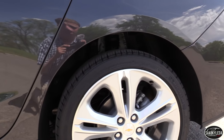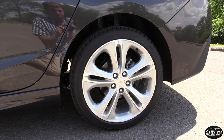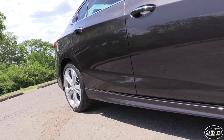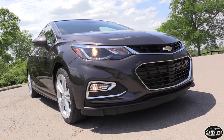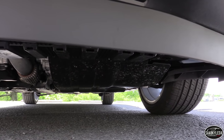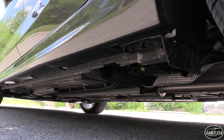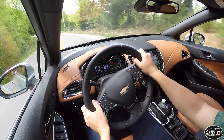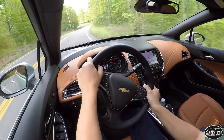As far as the brakes, the 10.8-inch front rotors are internally ventilated and use single-piston cast-iron calipers. The rear 10.4-inch discs are solid and use single-piston aluminum calipers. Four-wheel ABS, traction control, and stability control also come standard. Underpinning the Cruze is an independent McPherson strut front suspension with specifically tuned coil springs and a direct-acting hollow stabilizer bar. While the L, LS, and LT use a torsion beam rear suspension, the Premier features a unique Z-link design. More aluminum was used to lessen unsprung weight and enhance agility. The Premier's Z-link allows for linear vertical travel on both sides of the axle while preventing horizontal movement, leading to greater balance and enhanced stability.